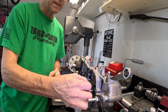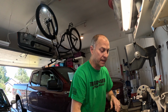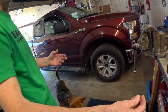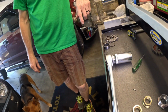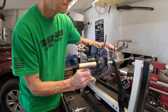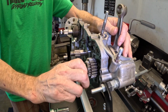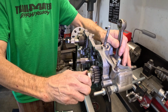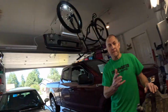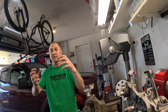One thing Mike did figure out is this motor does not take a gasket between the main cases. I suspect that there was an issue with that little clip, this little thing right here. Well, there was a little clip that was out on one of these, but I don't think that was causing it. Now this nut goes on here. Is that a 26 also? No, I think this is smaller. I don't know where it came from, but probably from China. I suspect that was indexed in some of these gears someplace and preventing things from moving properly.